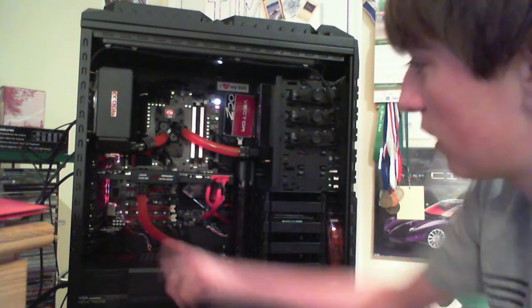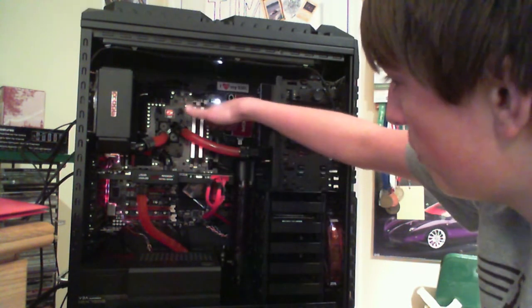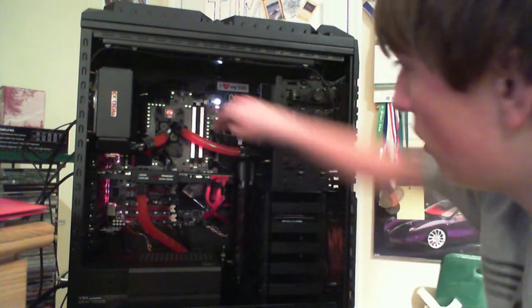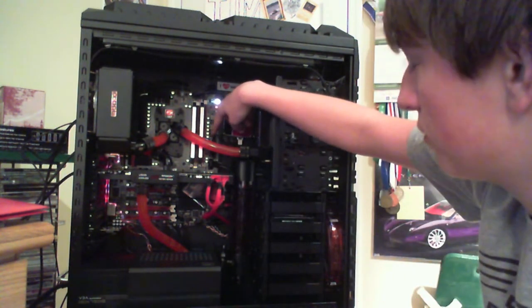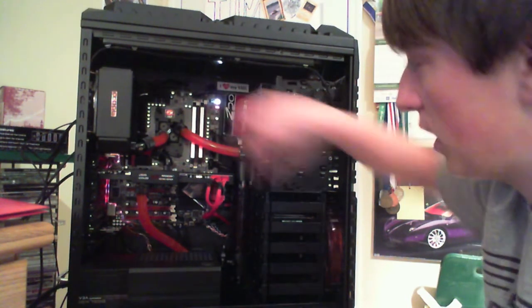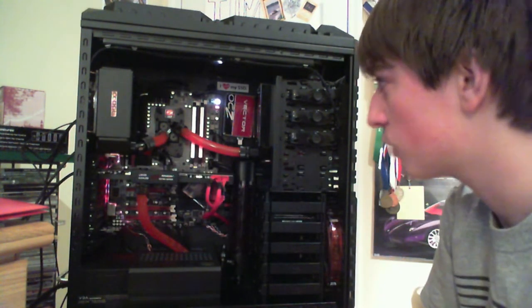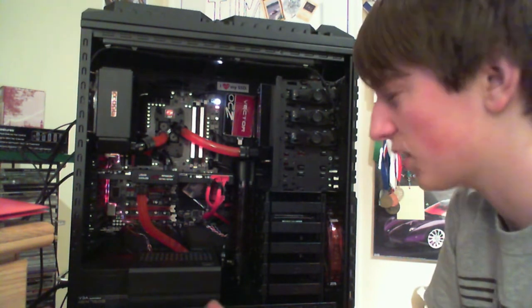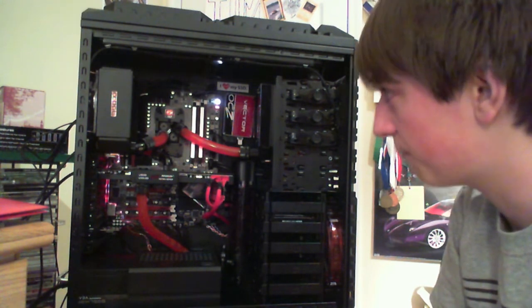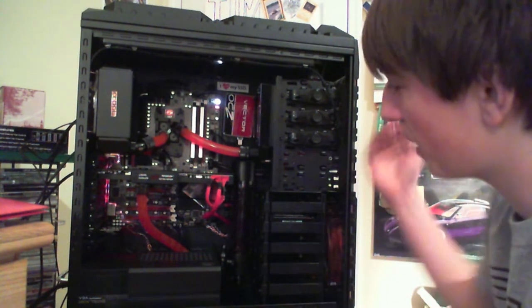It's got a lot of really nice features like the quick boot, the really nicely placed USB 3 so that way it's not above the 24 pin, so that way I was able to curl it down just below my GPU and right by my res. It also has a lot better placement of the 24 pin and a lot of the PWM fan headers, except for this one right here by my 24 pin ATX actually does not work for PWM, so it's just running this back fan at full speed, which is kind of loud, so I normally have it unplugged, but after like 6 or 7 hours of gaming or doing benchmarks or testing, it does actually get pretty warm, so I'll have to get that fixed, or I'll get a PWM splitter for one of the fans up here, and I'll just tie that in somehow. I'll have to pull off the back panel.